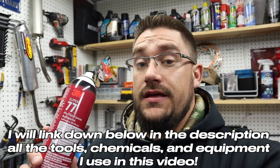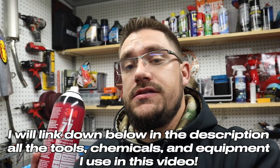For those of you unfamiliar with Super 77, it's basically an all-purpose adhesive — essentially carpet adhesive, used on headliners and all kinds of stuff. What I've learned over the years is I've mainly used this on gaskets: spray the gasket surface, spray the gasket, wait a couple seconds, throw it on, and you're good to go. I've used this for over 10 years and never had a problem with any sealing issues. It works really handy for those foam pieces too.